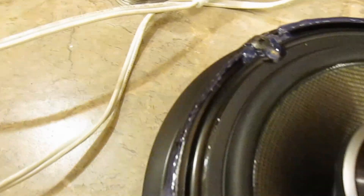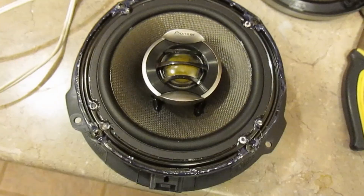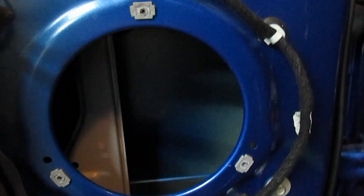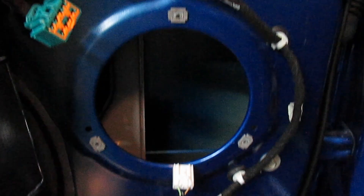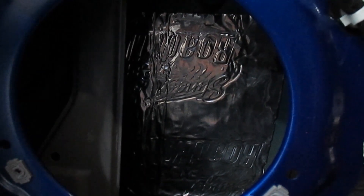This is what it looks like with the hot glue — not the prettiest thing but it does a function, and when the door panel is on you're not going to see it anyway. Before we put the speaker back in, I'm going to put a couple pieces of Stinger Roadkill in to deaden any vibration of the outer door panel. I'm also going to pull the plastic off and put some on that side of the door too.